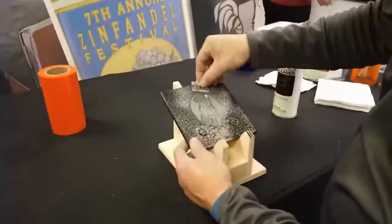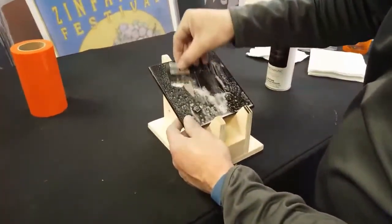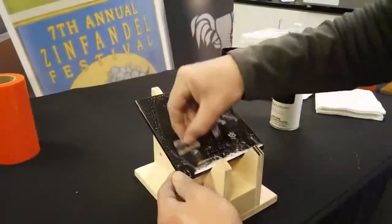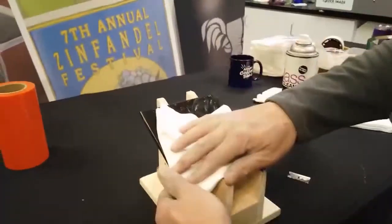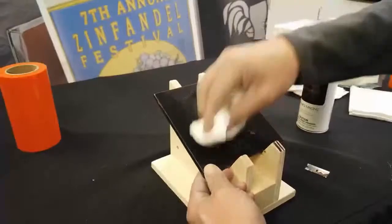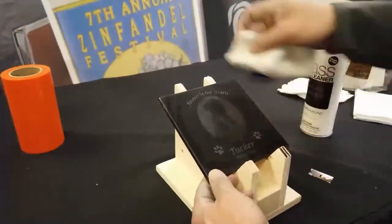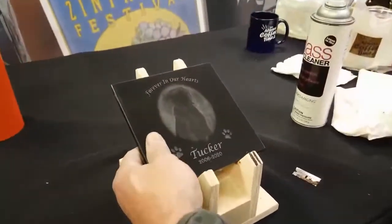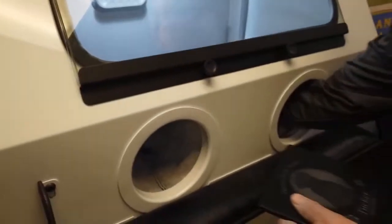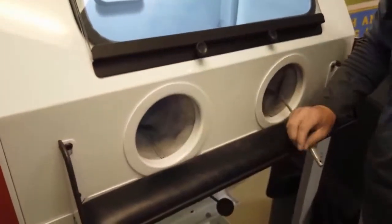As you can see in the removal method, I use a razor blade. I didn't use my hands because there are little dots, little pieces of film to pick away. The best method I find is with glass cleaner or a shaving-type foam or whatever, and then a really good clean razor blade. You just run it at a 30-degree angle to remove all that film, and it comes off super easy and polishes it at the same time, right? So it's a big time saver.